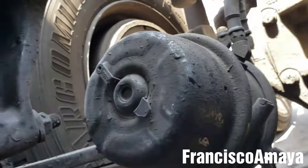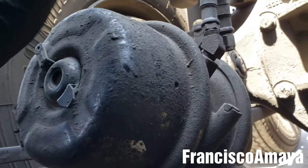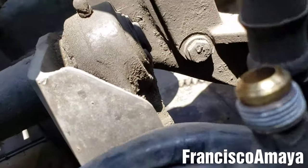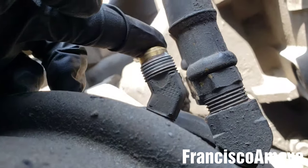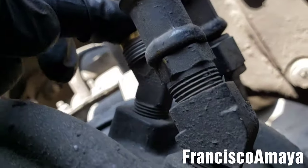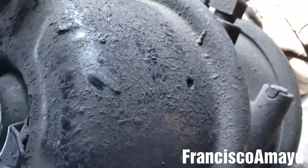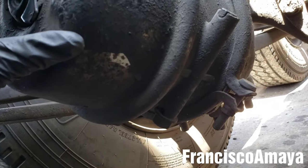Today I'm going to show you how it looks when it's bad. Right now the parking brake is applied and the brakes are completely released over here. You can hear this — that's an air leak. If I close it with my hand, see, that starts braking because there is pressure release. This means that this brake chamber is not good and it needs replacement. It is bad, so I need to install a new one.